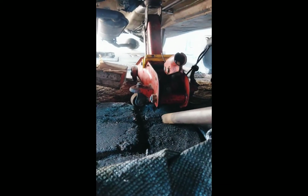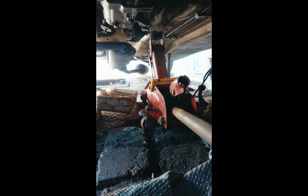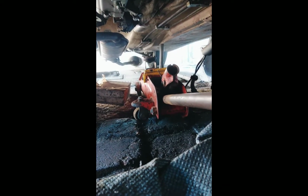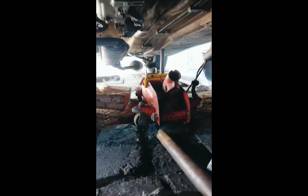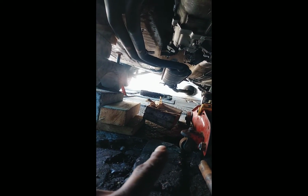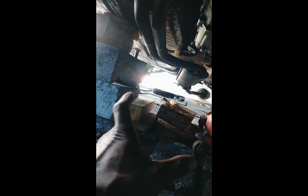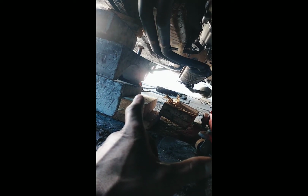I got a very good homemade tip from my uncle to use a broomstick. Basically, take the broomstick, shove it in the flywheel, and then take a knife and carve out the fitting of the flywheel, leaving a short stick, what they would use as the clutch tool when they fit it. Then tape it around the part where the clutch is going to be. That way it will sit nice and tight.